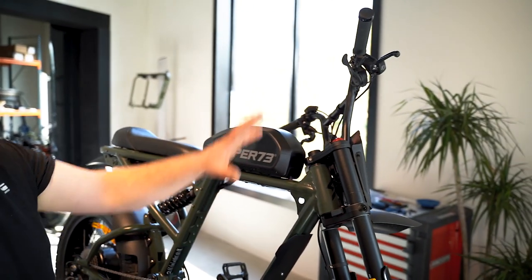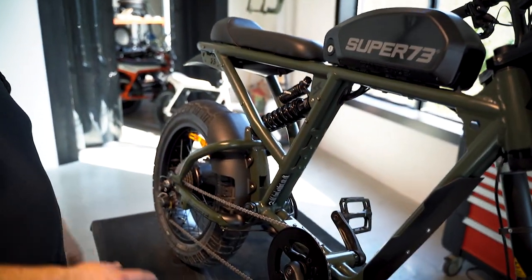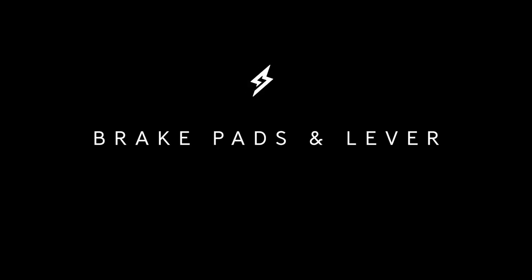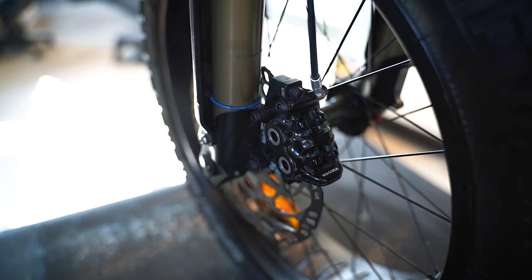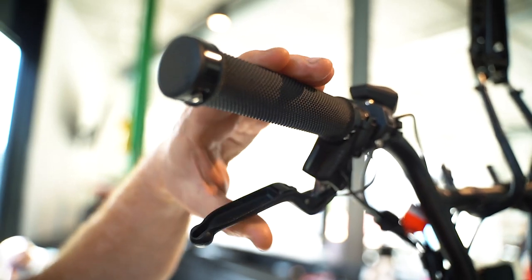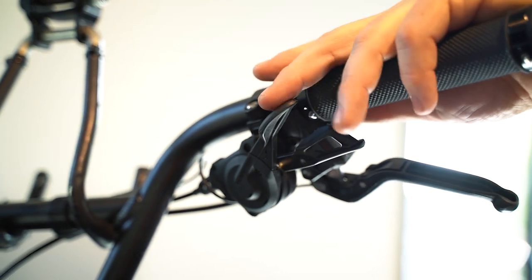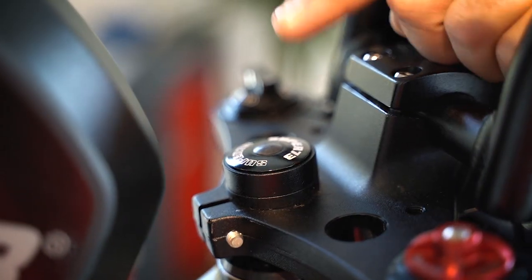The best way to ensure you cover all points on your bike is to start on top by the handlebars, go towards the back wheel, come back to the front wheel, and then you will have covered all points. Start by checking your brake pads for wear and tear, check the pressure of your levers if you ride hydraulic, and of course check the tension if you ride with cables. At this time also check your external gear cable and look for any potential play in the head tube.